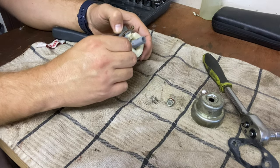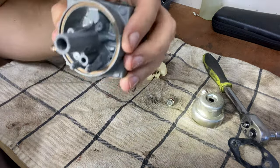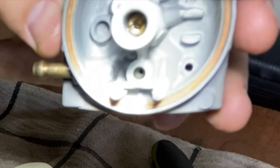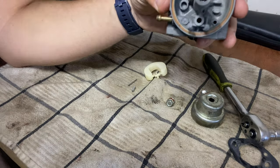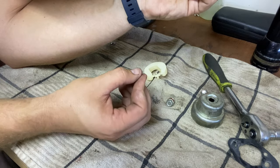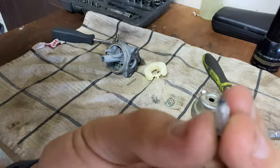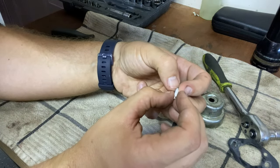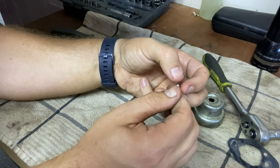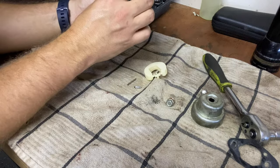I want to take a look at this needle first — let's just pull it out and take a look to see if anything might be clogging in there. It's a little gunky in there actually. So I'm going to blow that out. I have some carb cleaner here. Looking at that needle, it has some crusties on it. It makes me think maybe there's some buildup, because it was acting like it was running out of fuel when I would open it up. The needle feels like it's fine, but blowing on it with it partially open, it did sound like a bit of a restriction.